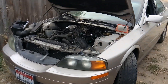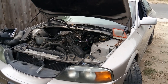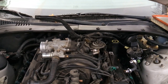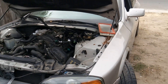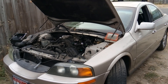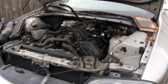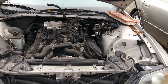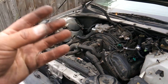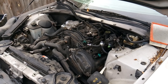In the meantime I've got a wife and four kids to feed, so I've accepted another diagnosis job. What we're looking at is a 2000/2001 Lincoln LS with the V8, so it's a 3.9 liter engine. The complaints are that it's just not running correctly at all — hesitation, loss of power, flashing check engine lights. Upon acceleration and deceleration it sounds like there's trash inside the engine, almost like a diesel or a rock grinder.